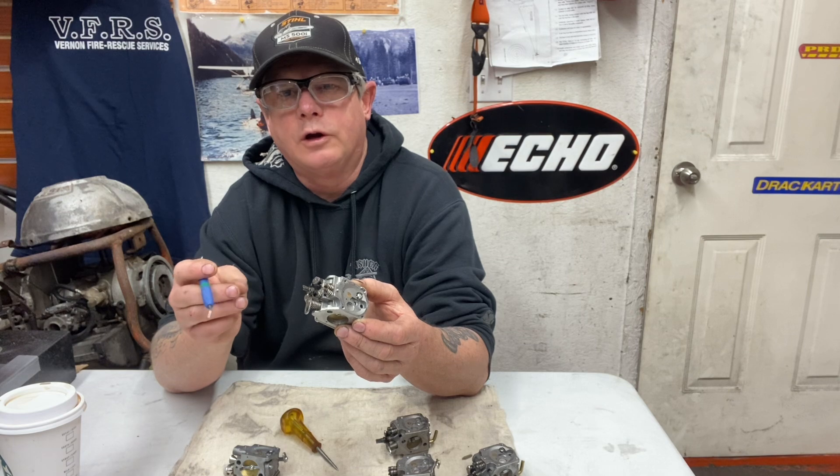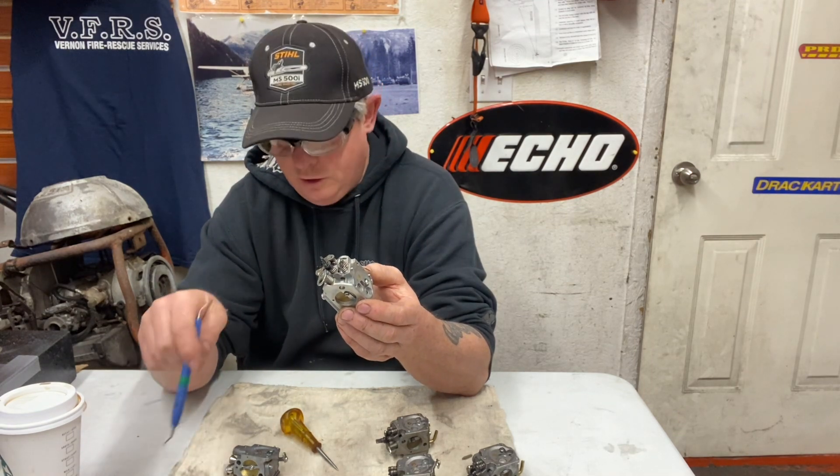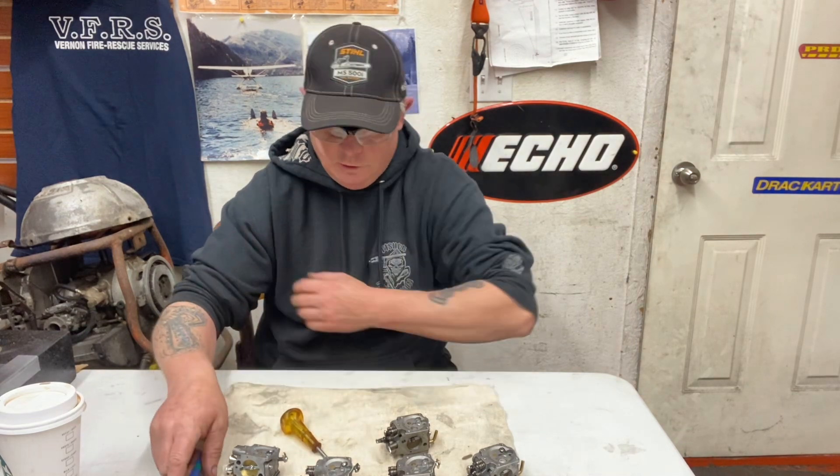You still need to make sure your metering levers are set at the right calibration — like setting a float on a car carburetor. Drill the idle circuit hole one size bigger and the pulse hole one size bigger and hopefully that'll help your 394 carburetor hot start. Yes, ignition coils can go bad — usually they're just dead or sometimes won't refire when hot. Some on the 394 and 395 have had issues, but not that many. Make sure you've also done pressure and back-leakage testing on your engine and that your fuel lines are good.